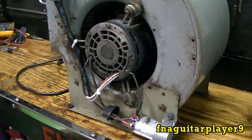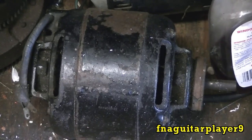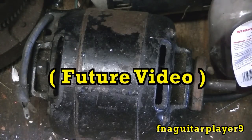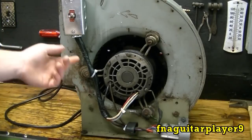This doesn't have to be a capacitor start motor like this — it can be a motor that has starting windings in it. For example, a motor like that, because they have a centrifugal switch inside, and when it comes up to speed it unhooks the windings. But if you turn the motor — like wrap a rope around the shaft and yank it like you're trying to start an engine — it'll actually run in whichever direction you start it, as long as you plug it in before it stops spinning.